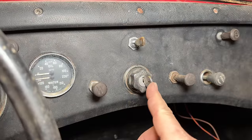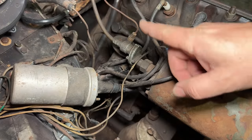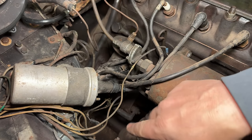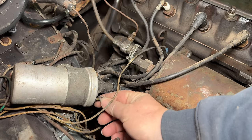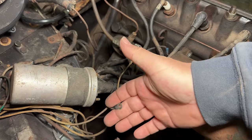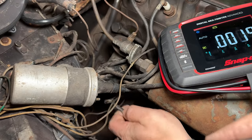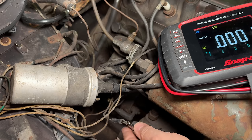So we'll need to take a look at this wiring. I just removed my switch that I had connected to the battery and then to this side of the coil, and there was not another wire hooked up to that. I imagine this is probably the power wire that goes to the coil, but I'd like to test it first before I hook it up. The colors on all the wiring are faded, so a wire diagram is not going to do any good. I'll just have to test these myself.